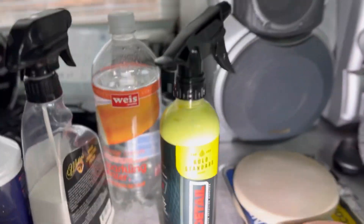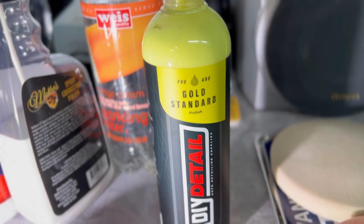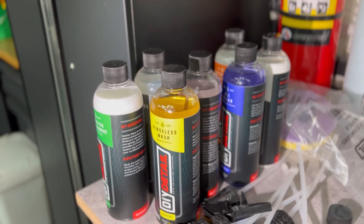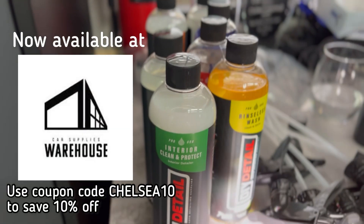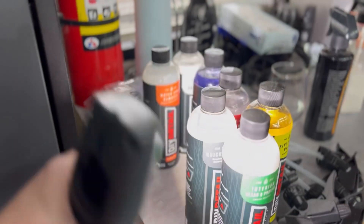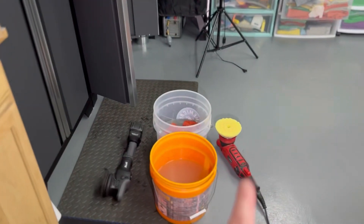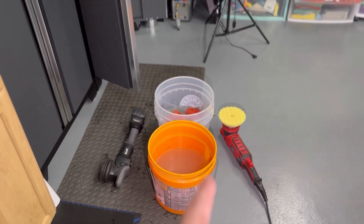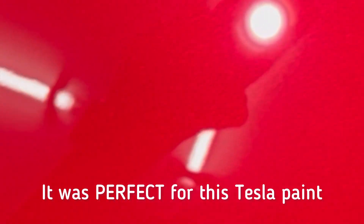Then I realized — this was just sent to me the other day for me to test out — this is DIY Detail's Gold Standard. This is new from Ivan LaCroix and Nick McGurk. They have their entire line of products that they just sent to me. I've been working with a couple of them and I've been absolutely loving their rinseless wash, their quick beads, their ceramic boost, and their interior ceramic protectant. It is a yellow waffle pad. Typically yellow pads are more firm and more aggressive with correction. I was worried that it wasn't going to work, but we were able to remove all the defects on the paint. We don't have that micro marring around our light and we don't have any sort of ghosting whatsoever. This did a fantastic job on even this Tesla paint — very impressed.